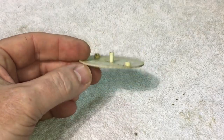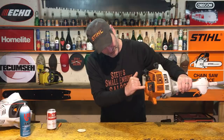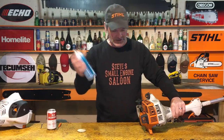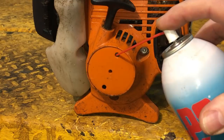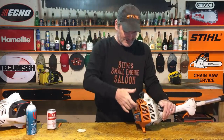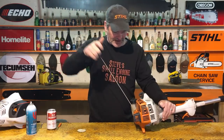Once you've got that disc off, you're going to see some little holes around the outside. See those holes? If you had a flashlight and looked in there you can actually see the starter spring. Super easy to do. I usually go in at the top — put a couple good blasts into the hole that's closest to the top. Blast it in there like that. Now it's draining down through that starter spring, and you just have to exercise it a little bit. As you pull the rope out and keep pulling it, it's moving that lubricant around in there and lubricating that spring.